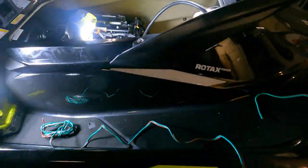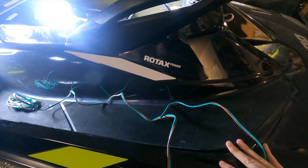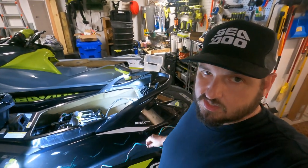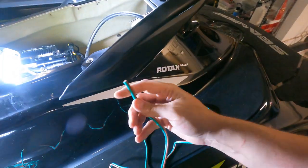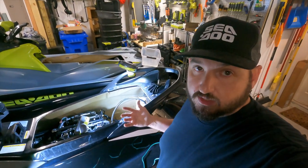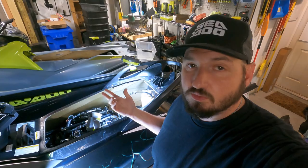While we're waiting for that to dry, I've got some leftover trailer wire. It's a little bit thicker than what I need, but that's fine — as long as it's not thinner. The owner's manual says you don't want to go any thinner than 18 gauge, so this is like 12 gauge. You can use whatever automobile wire you've got. Most people would go with red or black, but the color doesn't really make much of a difference as long as you know where it's going.